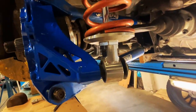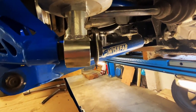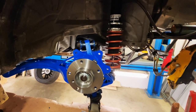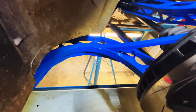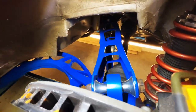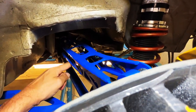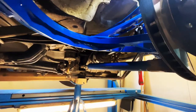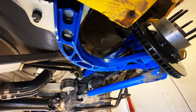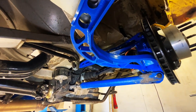Another major advantage of this trailing arm is the reinforced shock mount, which you can see over here. These are sadly starting to fail on these cars because the trailing arms are getting old and have had a hard life. This is much stronger, especially if you want to run a full coilover — it gives you a lot more room for axles and maintenance. There's no real technical advantage to a full coil but the packaging is a lot nicer. The V2 arms give you even more room, and as you can see everything is very accessible for your driveshafts. You can run this on a full stock body car as well, or with a divorce setup, but you need to notch the original upper control arm a little bit.